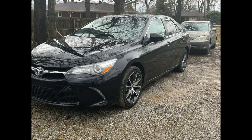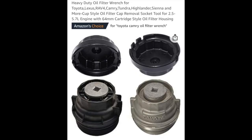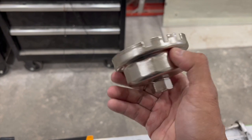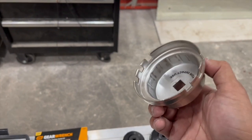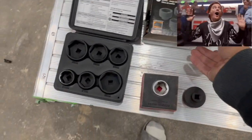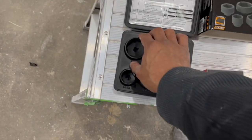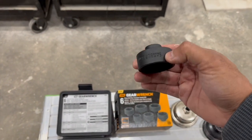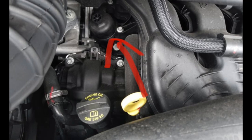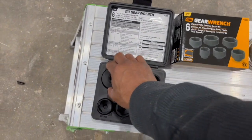I just got a new car — 2017 Camry — and it's got a special oil filter wrench just for that engine or that car. But yeah, if you see some weird kind of paper filter, you want to get the proper oil filter tool or you might end up stripping it, because they're usually made out of plastic. I got this one — I think it's about 30 to 40 bucks from Gear Wrench — and these will go over a lot of BMWs. Even my old Pro Master had it: there'll be an oil filter right near the engine with a plastic cap.